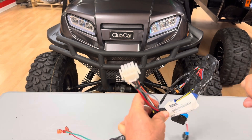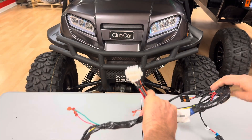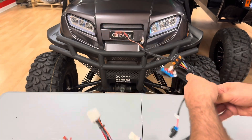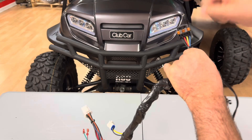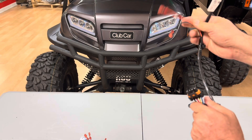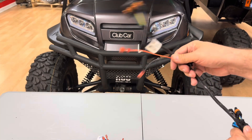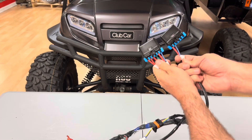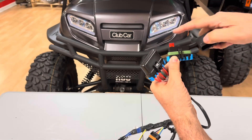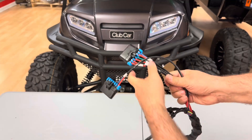This is where the harness plugs into the end of the lighting harness that runs down the floorboard and back to your battery. This is another optional accessory plug you may or may not have on your car. A little further down, this is a headlight wire that plugs into the pigtail coming off the headlight. And then this is the other headlight, with the orange and black wire that plugs into your horn. The short one goes to the passenger side, and the longer one goes to the driver's side headlight. The only other thing left are these two fuse blocks for your light harness — the mini fuses just pop off right here. I like to tuck these back behind the dash where they're fairly easy to access in case we ever need to service the fuse blocks.